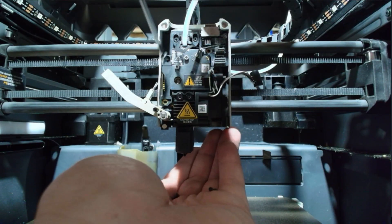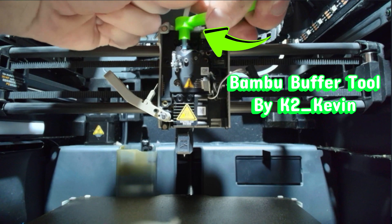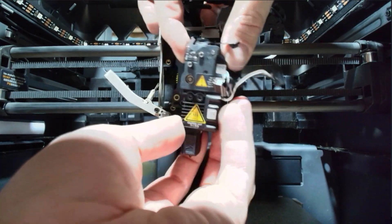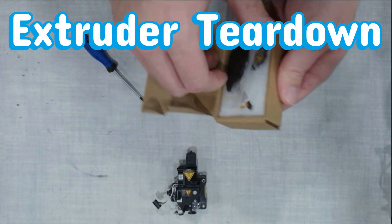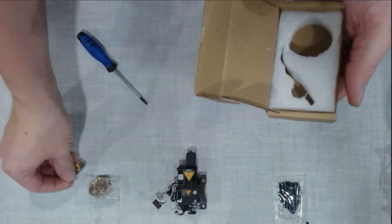Here's a neat little hack to save your ribbon cable from an early retirement: use the AMS Subtool by K2Kevin. We tried a screwdriver once, and it didn't end well. This is where the assembly comes out for teardown. Just ease it forward and double check that all cables are clear. Now it's time to unpack the Panda Claw and Panda Extruder. As you go, keep everything organized and hold onto your old extruder parts, since some of them will be reused.